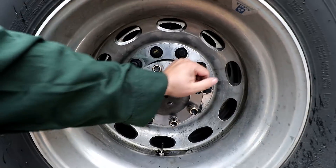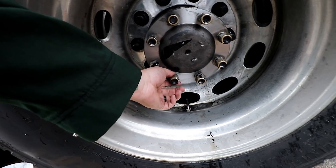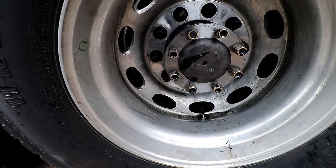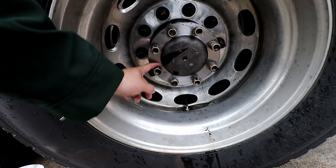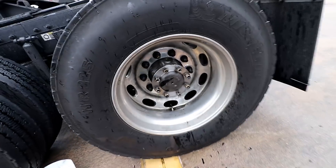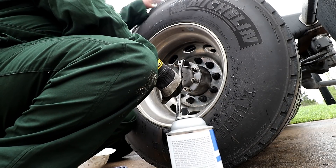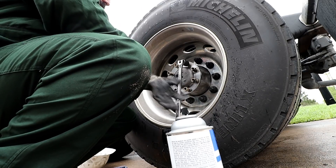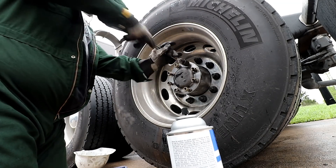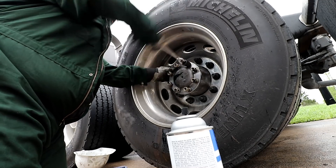One of these didn't have an O-ring — well, a washer — and I don't have an extra washer, so I'm just going to put it on like that. Maybe later I'll get one and put it back on. One of them didn't come with a washer from the get-go — that might be why it started leaking. Okay, let's get it all back together. As always, I always forget to put gloves on. I'm going to go across and then try to tighten it down, try to get it nice and even.